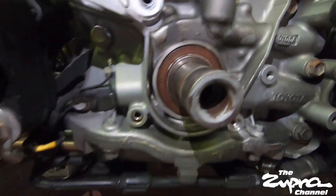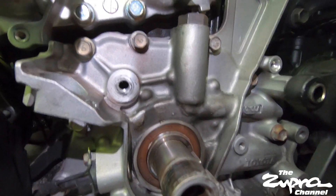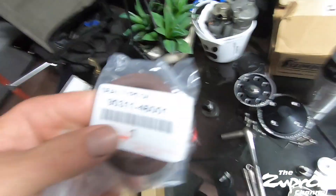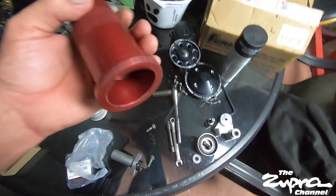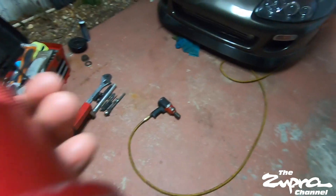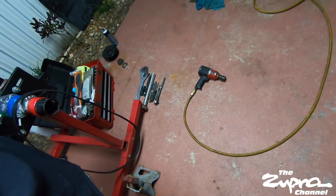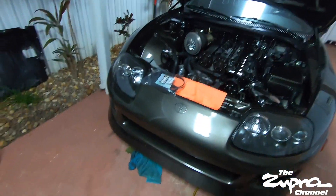The seal doesn't look all that bad but I'm here now - I don't want to deal with this again. I just want to put it back together and have peace of mind. I was able to track down our front main - I had a spare. I'm going to change out the front main since it's leaking a little bit. I passed by my buddy Abraham's place and he gave me this tool I've never seen before - it's to insert the front main seal. This part goes on the crank, you screw it on, and then this part pushes the seal in by tightening a size-14 nut on the back - as you tighten it, it pulls back and the seal gets pushed in. Pretty neat.